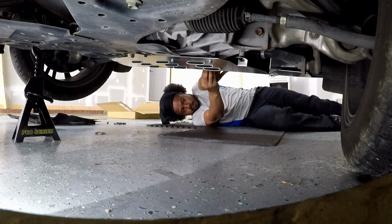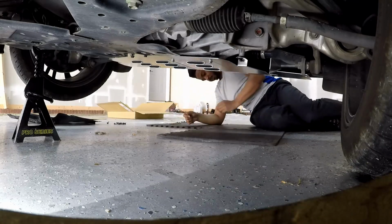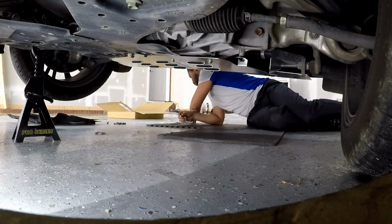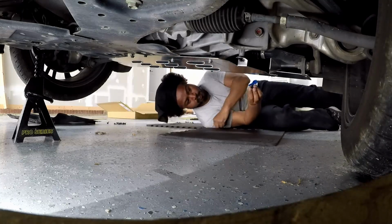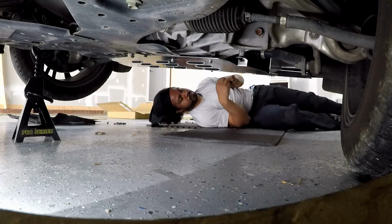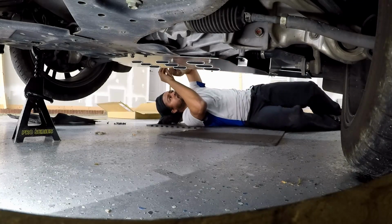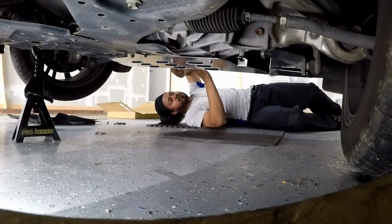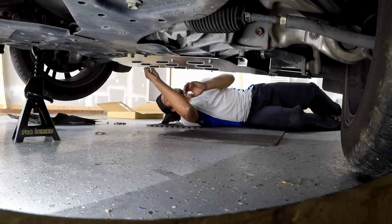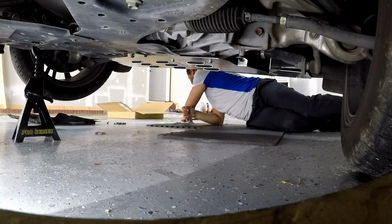Yeah, it's a VR30. It is a turbo. The heat exchanger is going to bring down the temperature, but you're starting off at a higher temperature that the heat exchanger has to deal with. So you want to start off with the lowest temperatures you can get, and then that heat exchanger can get it down even lower.